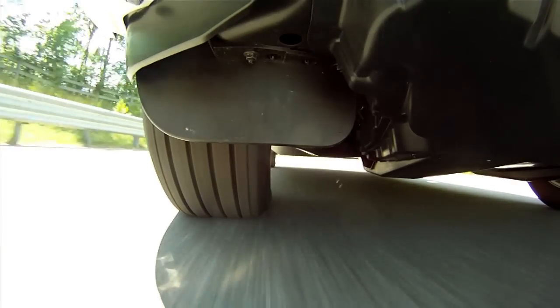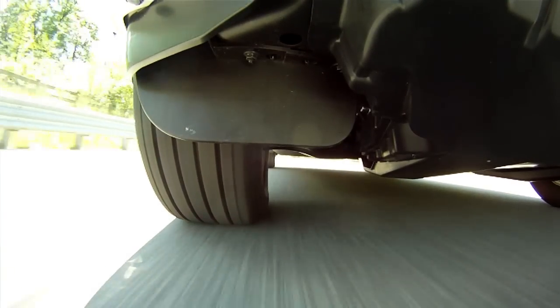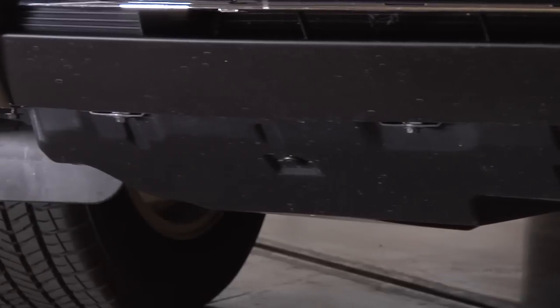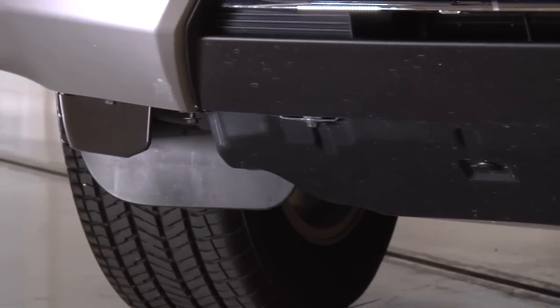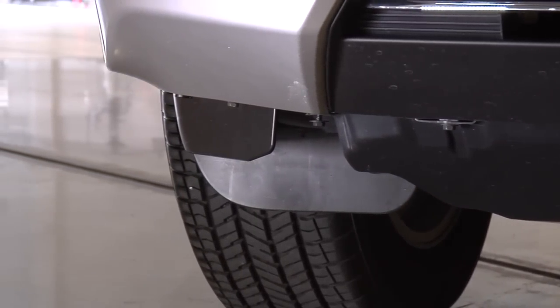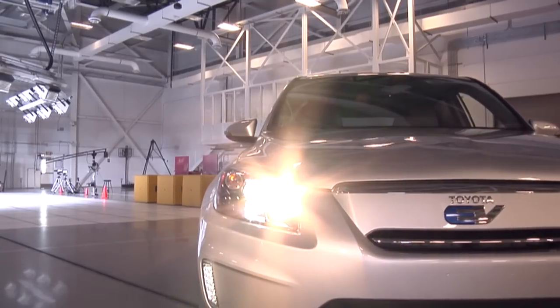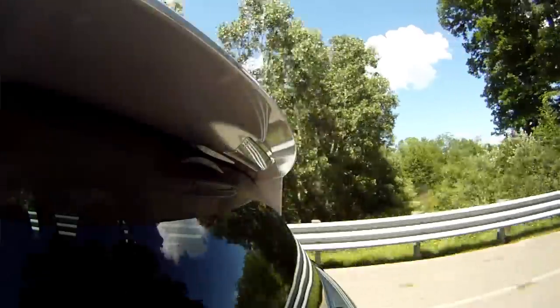Since we're using an existing vehicle, we wanted to maximize the bumper styling. We looked at rolling resistance coefficient to minimize tire-to-road friction. We also used spats — pieces placed underneath the vehicle to direct airflow around the tires and improve drag — and wanted to maximize the headlamps and rear spoiler.